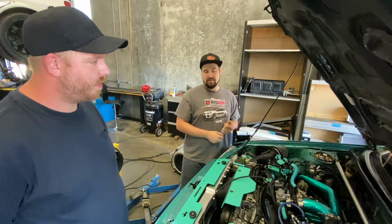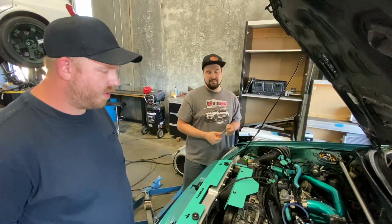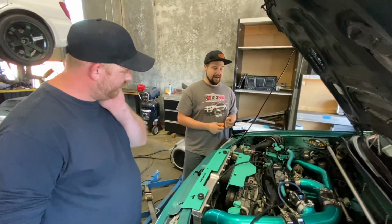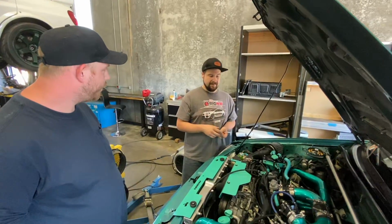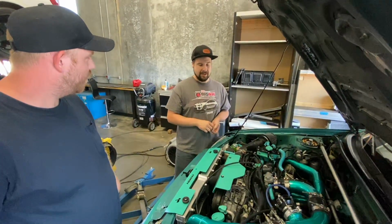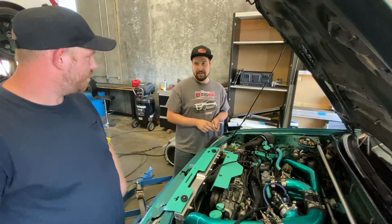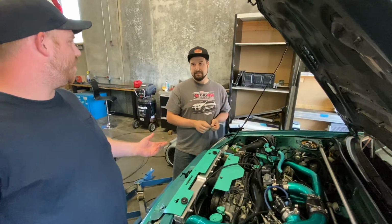So, then you'll throw a code for fuel pump circuit, but I'll take care of that when you come back and we can retune it. But for now, I don't have any fuel. I can't do anything. That's understandable. I cleaned up the fuel tables, the startup, the idle. I cleaned up all that stuff, so it should be better for you. But we need more fuel to get safe power. So how would I do that? Pay the $500 now or whatever for that?